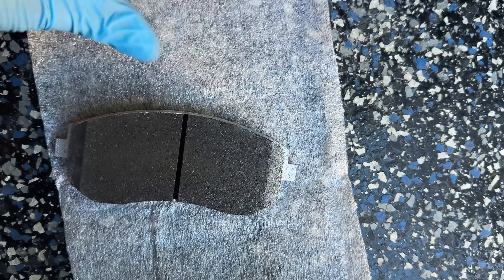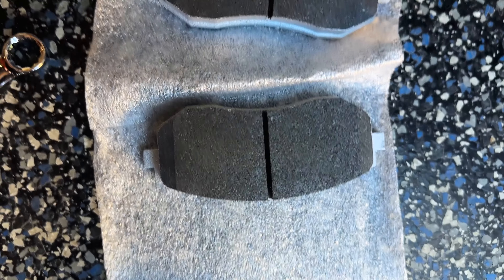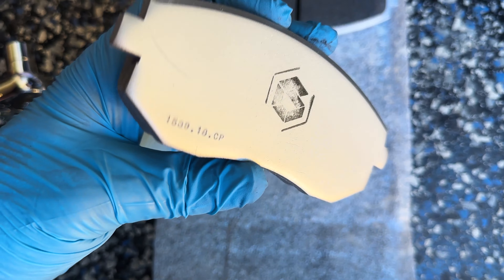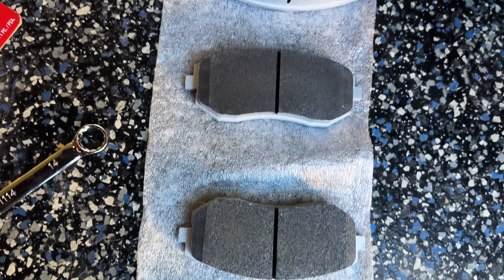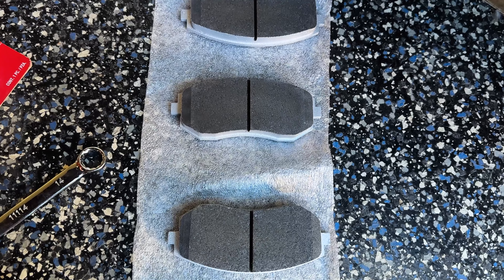I'm using Counterspace Garage CP pads. These are for street and track duty. If you're just driving around on the street, you don't need anything like this, but this is going to be a dual purpose pad. These are designed to work extremely well under high temperatures and not fade under track use, but also not squeal on the street. These are a compound I've been using for a long time, developed over about a decade. By the way, I'm not sponsored — I actually paid for these with my own money. These are high temperature CP grade pads, and they also have a number of other pads. I'm using these today because I'm planning on taking my car to the track.